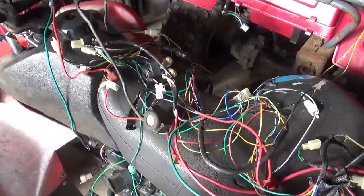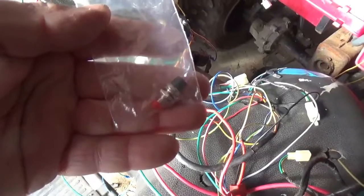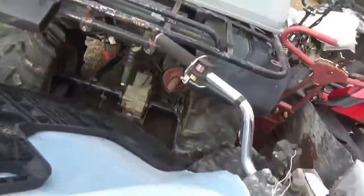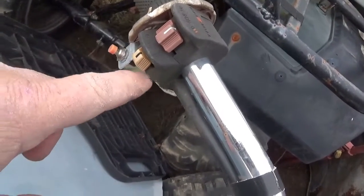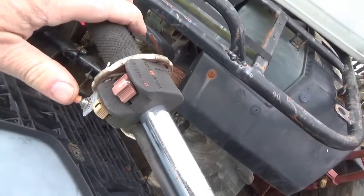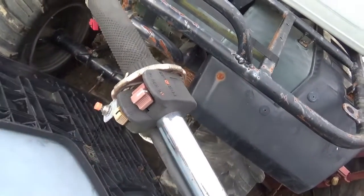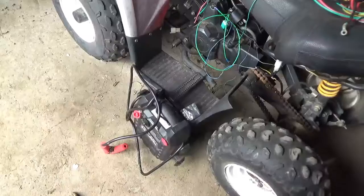In addition to this pile of junk, I'm going to add this push button. I don't know if you guys remember working on this TRX 200, but they have an add-on button for the starter and they always go bad on these things. So I added this little push button and it worked out so well — you just hit the button, it uses the same bolt that attaches everything. That's why I'm going to go with that. Leaving this out in the weather is not a good idea, so try not to do that.